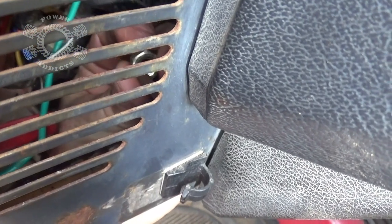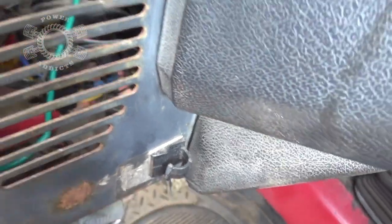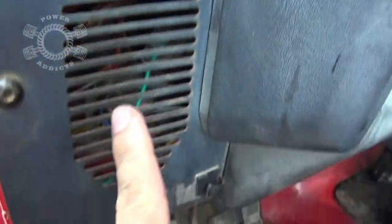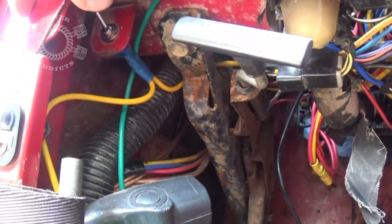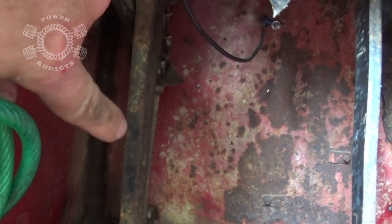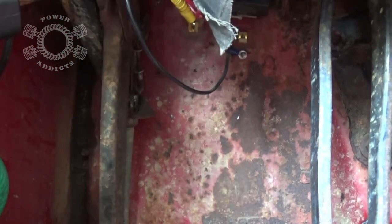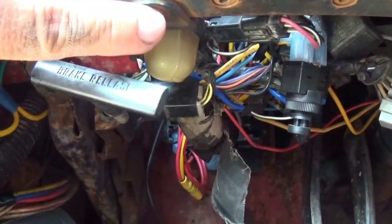As you can see looking through the speaker grill, I'm sliding those nuts on as spacers to hold the speaker out so the mid and tweeter don't hit the face. I've already got the ones up here, here, and here — I'm not going to fight that one in the corner. Another thing that will help you access the speaker is just taking the e-brake out: you've got one bolt right there and two in the back. There's a stud that goes through the wall — you'll notice it actually on the other side of the firewall — and that little light right there, a Phillips-head screwdriver, take that out of the way and it makes access a little easier as well.